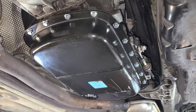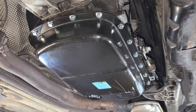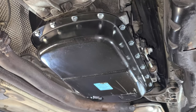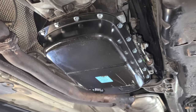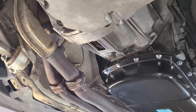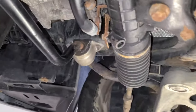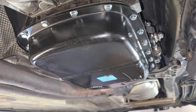If you exceed 50 degrees Celsius, you're gonna have to shut the engine off, plug the hole up, and wait until it drops back down to be in that 30 to 50 degree range. It's very important that you're there. Beyond that, for this vehicle, I just have to put the center brace and the under tray, and we are done. The problem has been addressed in my case.